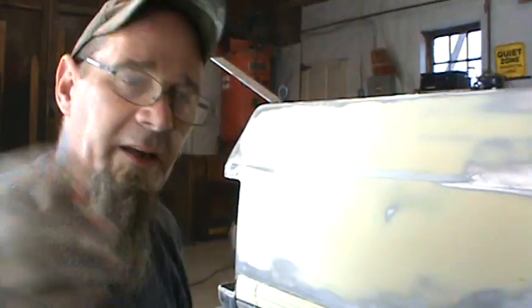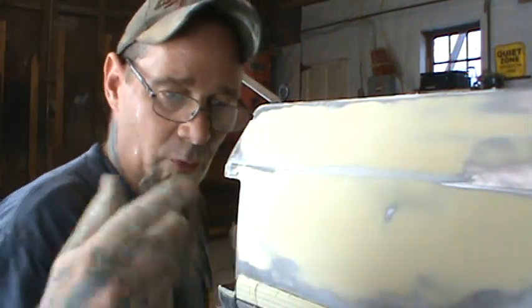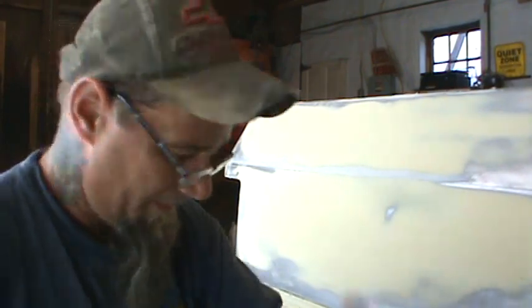So one — or actually two — of the white Bondo, because I was unsure about something and I decided to put another lick on. And it's my first lick of body fill, of the Platinum. I do have to go a little bit further, but right now I'm just concentrating on this area over here. Right now it's really high here. I'm not going to take any more than that off, so I'm going to put some tape on this part here, blow this off, then we'll go mix some Bondo and put a lick on with you guys. Now I'm just going to go with the pencil line that I have here, which is quite noticeable, and then we'll go one way lower so we probably get it on this panel.